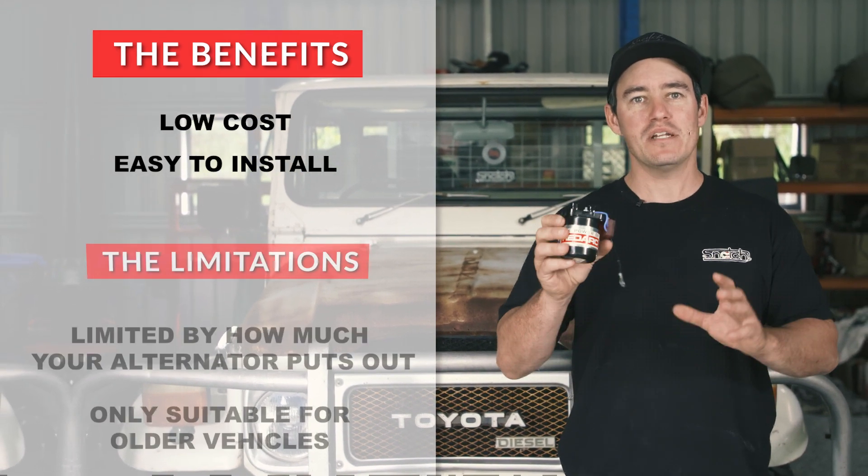The second is how many amps all your accessories are drawing, because it's useless knowing how many ampere-hours your batteries have left if you don't know how fast you're using them. And finally, how much charge is going into your system from your solar or your alternator — important because it'll give you an indication of how fast you're topping up the batteries. Because the Manager 30 can measure all three, it can give really accurate indicators of how many days and hours I have left of battery life before I need to do something about it.